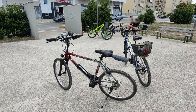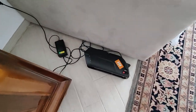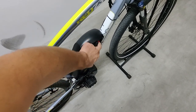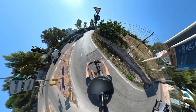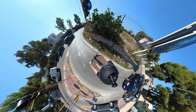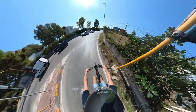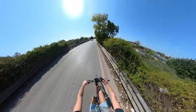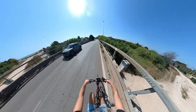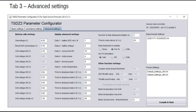For more details about the experiment, go check that video. But basically, it was a 10km round trip with the same exact battery, fully charged at 42.3V, measured using the voltmeter of the P850C Bafang display. The bike was well pressured and the wind was below 6km/h. I was mostly below 35km/h because of cars and some irregularities on specific trails. Only when on a free, flat road was I able to stay at a constant 38km/h. The difference was that this time I didn't have to touch the throttle, not even once. By the way, the throttle is still jerky compared with the BBS-02B — if you use it when pedaling, you don't feel any extra help from the motor, and when replacing pedaling you won't go as fast as you'd expect. Maybe I should change something about it in the parameter configurator — let me know if you figured that out.